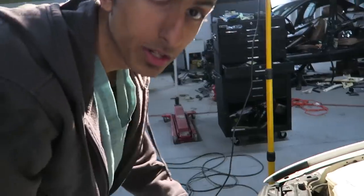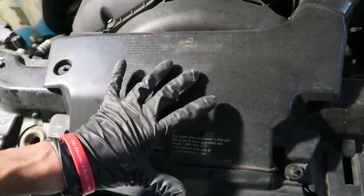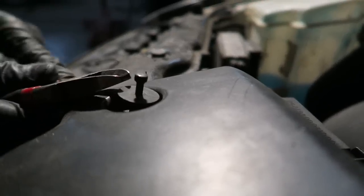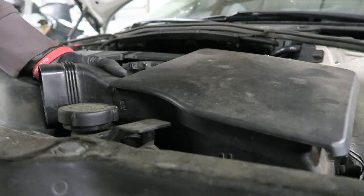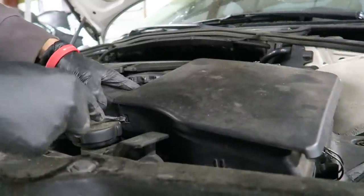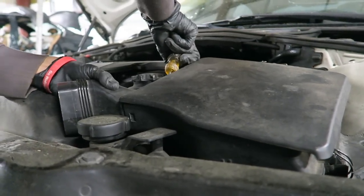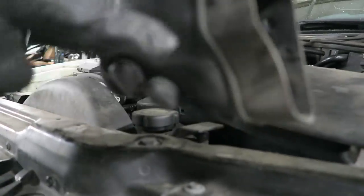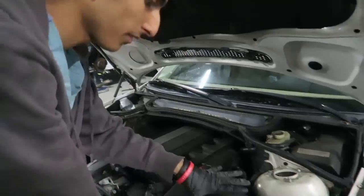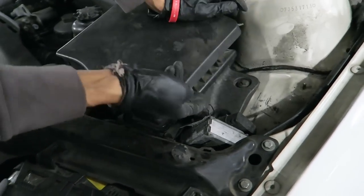Go ahead and take off the air box. As you can see, there are three tabs holding this in — this is just the front air dam. To get this joint off the air box, there's one tab here and two tabs on the other side. You just push them in and they pop out — just like that. You can see two tabs on this side and one tab on the other side. Next, we're going to take off the air box cover. They're like little clamps — you pop them up from the bottom to get the metal piece to come off, and there are about five of them.